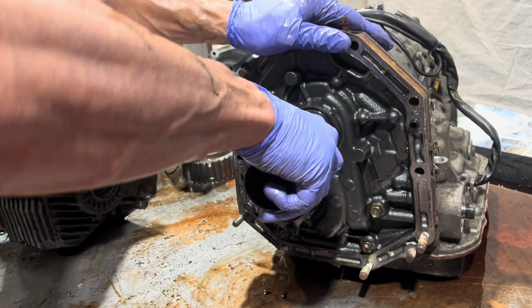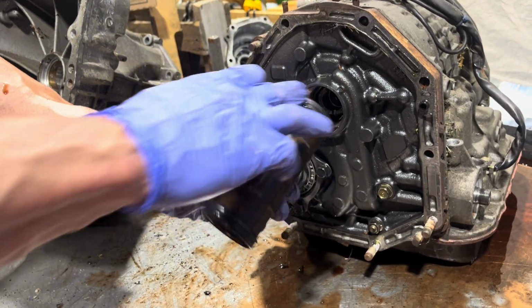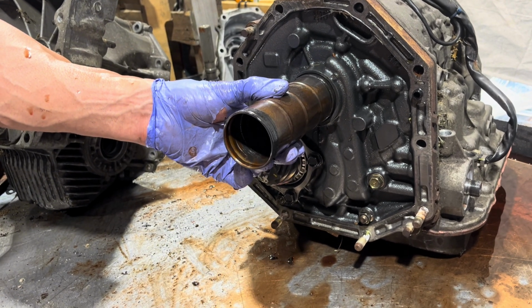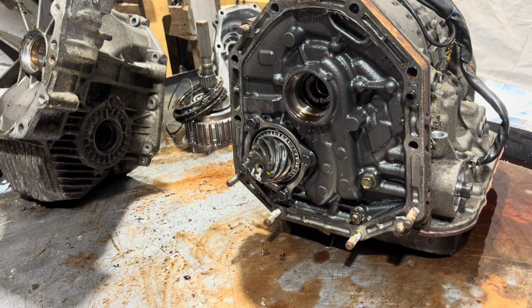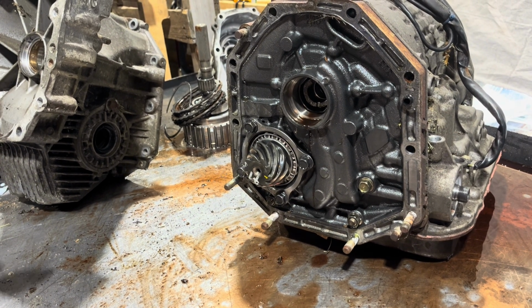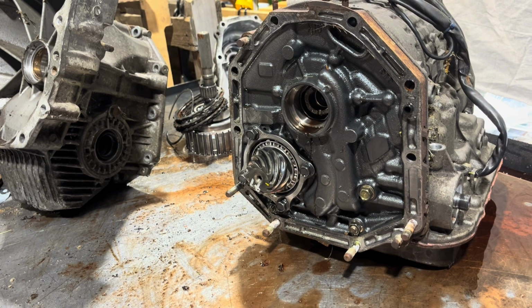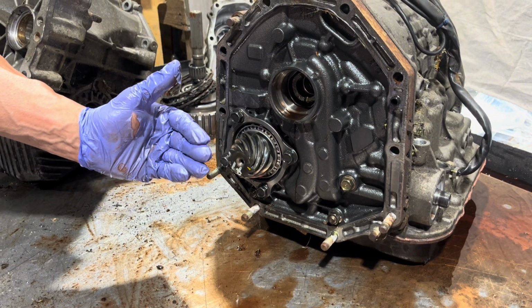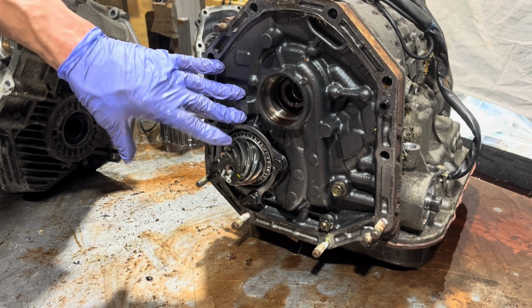Place number two is this thing, which you can replace. It's got a rubber seal on either end, right? So this is still keeping your transmission fluid and gear oil separated. And the third place, which we can't see yet, is you have a housing on the back side of this. So there's a seal facing in each direction. One seal's holding gear oil here. The other seal is holding ATF in the transmission.